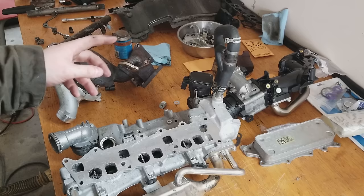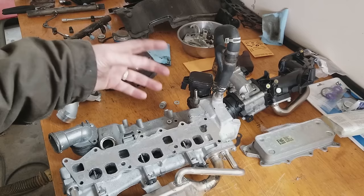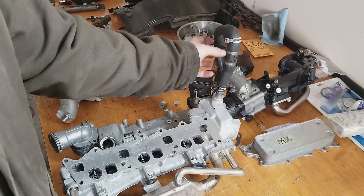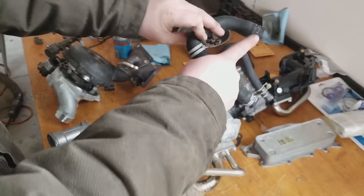The only thing that needs to be removed are a couple of coolant hoses that are connected. One of which is right here that you have to take off. And then you have the option, based on what's easiest to get to. There's a connection up here that goes to a tube coming out of the firewall. You can either take this hose clamp off here, which I did, and disconnect this, and then pull this line out with this manifold right here. Or you can disconnect here and here, pull this off, and pull it out that way. I think it's actually easier just to disconnect this connection right here and pull it out that way. But whichever way you choose, it's up to you.